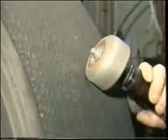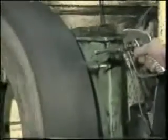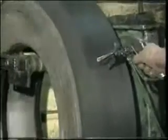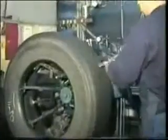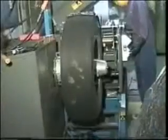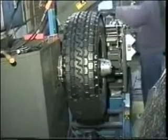Next, the stem appearing above the tread is cut off and the area is buffed. Repair is completed as shown. The surface left by the removal of the tread is coated with cement all over. The hollows are filled. A pre-cure tread is stuck onto the tire.